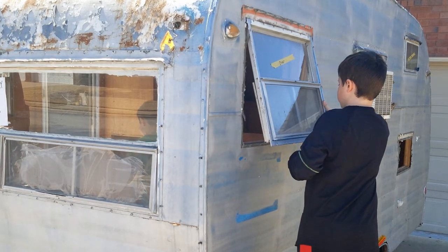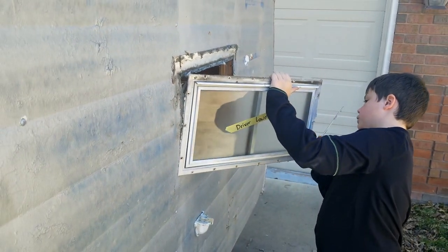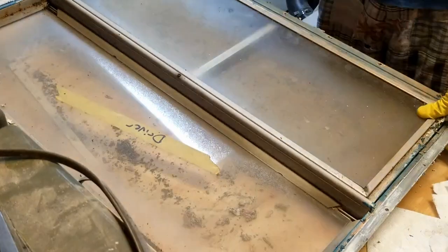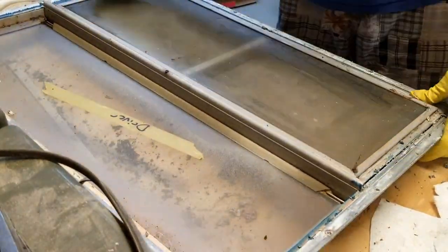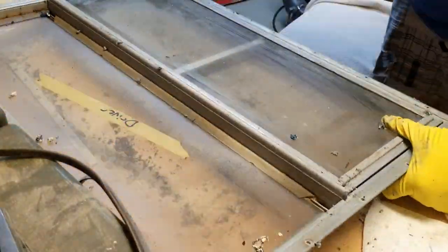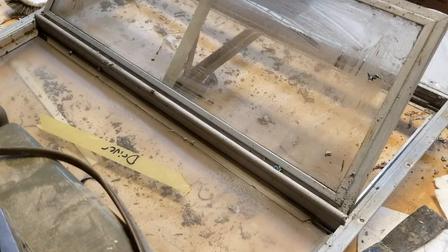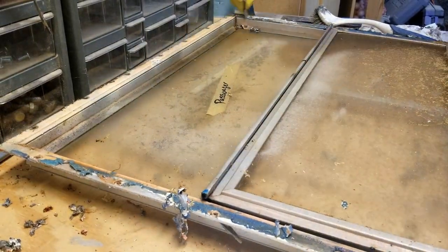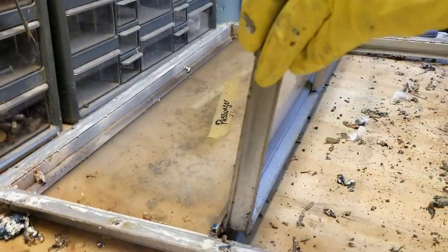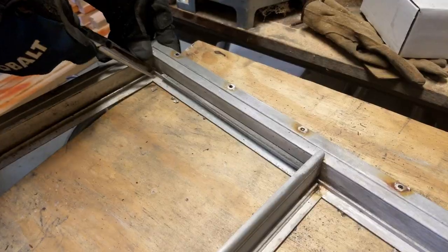Taking us back, this is how we remove the windows. You'll notice there's a gray substance on the backside — that's the butyl tape. It hadn't been replaced since the trailer was built 65 years ago, so it was still a little bit pliable. The first thing I was doing is stripping the windows, removing the paint. The trailer had been painted several times over the windows. A standard paint stripper works great. Sometimes you need a second coat. The main thing is don't use a metal scraper — it'll scratch the aluminum. A stiff dish brush works great to remove that paint.